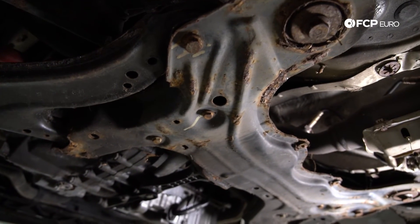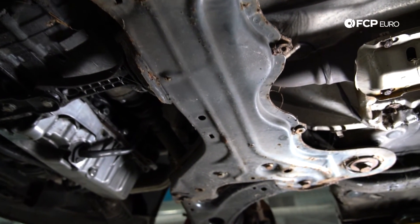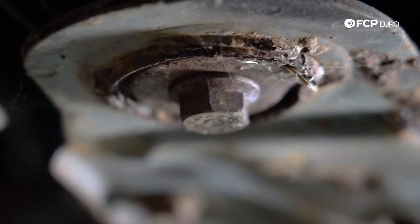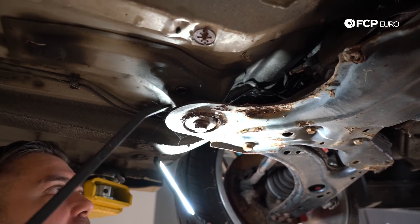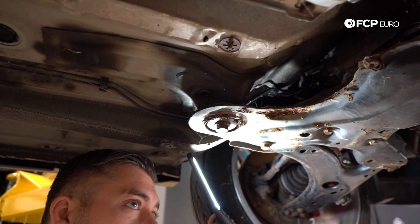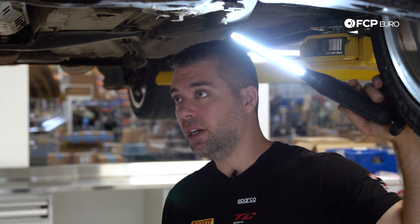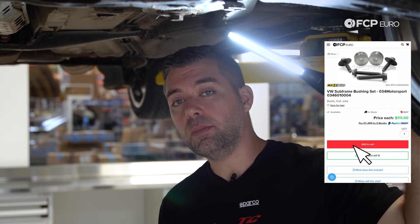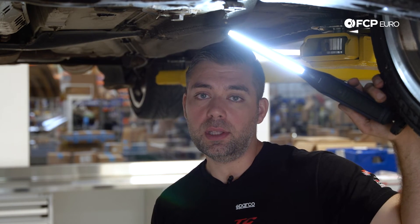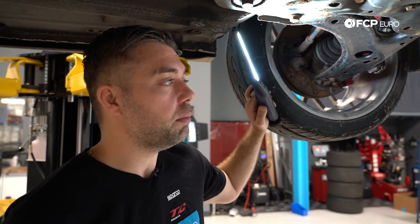The last component on the front of this car is the actual subframe — pretty critical, as it holds your entire front suspension together. Your lower control arms connect to it, and then this connects to the body. One of the main failure points is the rubber bushings, located right here. When those go bad, you can get slop in your suspension and steering feedback, plus groans and creaking noises. We sell replacement bushings on the site — OE options and also aftermarket performance options, whether you go with the solid aluminum version from 034 Motorsport or polyurethane bushings from PowerFlex.